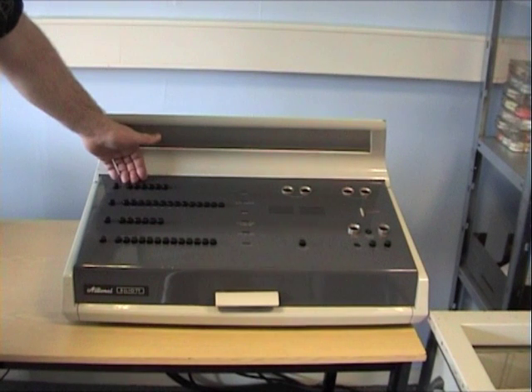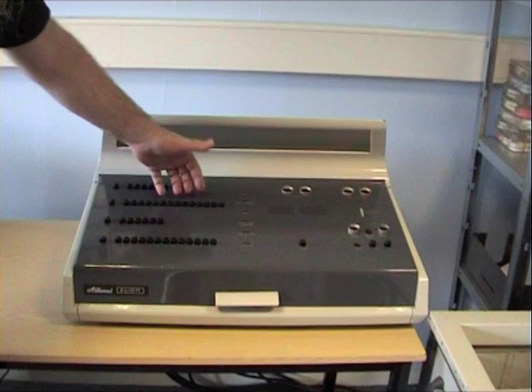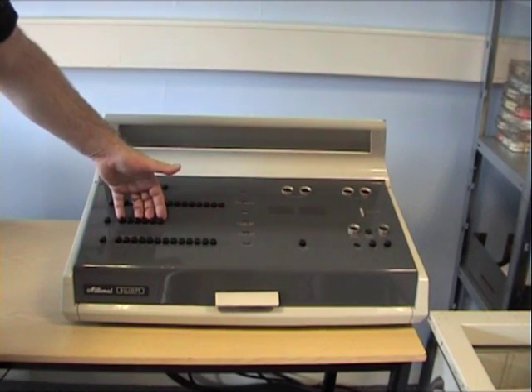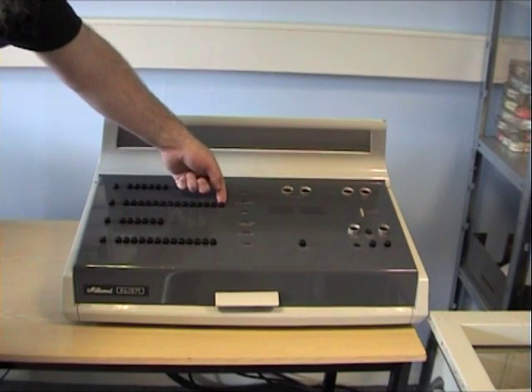On the left hand side here we have what's called the word generator. These 39 buttons correspond to the 39 bits in the machine word and are laid out in the same way. So you have two 6-bit opcodes, two 13-bit addresses and the B modifier bit.